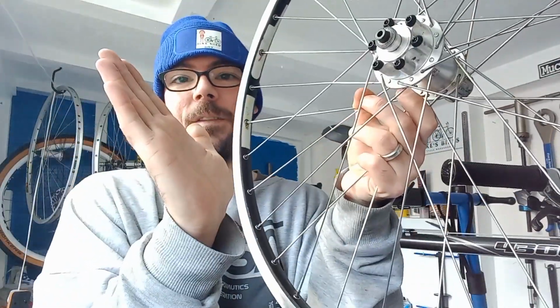And then I can just finish up this bike, reset that brake, and then I'll give you a quick run through of the brake being set up. Because obviously we're going to swap those spacers from one to the other to bring those brake arms in line, so they're not sitting like that. As you saw at the beginning of the video, you'll see once I've done that at the end of the video. So keep watching, let's go from there.